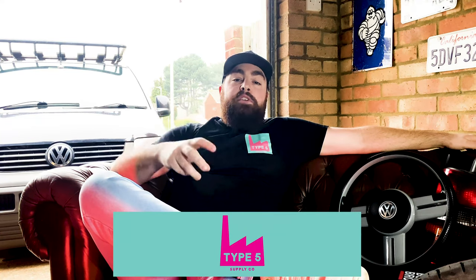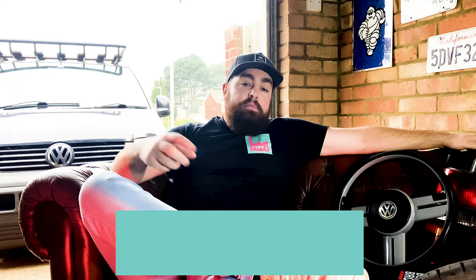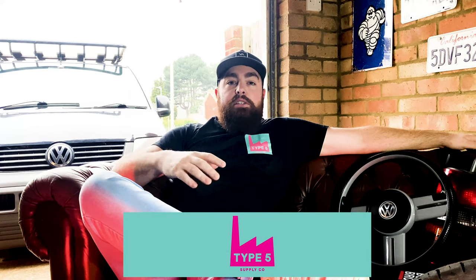Another option — and obviously we're on YouTube, so wrapping your van. You can take it to someone to wrap it. It's not a difficult process, but it's difficult to get right. What you do is cover your van in a big sticker. The advantage of a wrap over paint is price — wraps tend to come in at between fifteen hundred pounds for a lower half wrap to three, three and a half grand for a full wrap, depending on who does it. You could do it yourself; there are videos on YouTube. The other advantage is changeability — you can peel it off and stick another one on. In my eyes, a wrap never has the depth of a good quality paint job, but I'd rather take a good wrap over cheap paint.